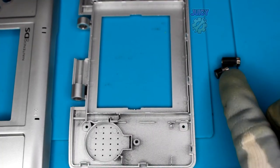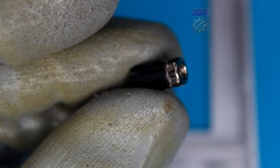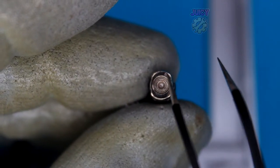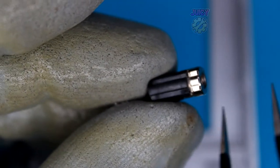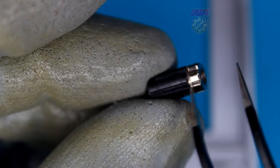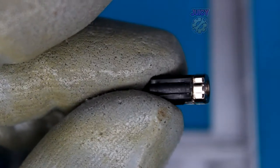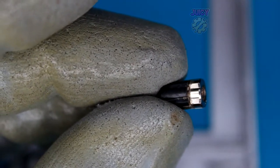Now let's replace the DS hinges. You need to get your hinges - there are two parts: a metal bit and a black bit. On the metal bit there's a bump on either side, and this bump needs to match the black plastic bits, which look like three lines. Check both sides match like so. Set up your hinges so we can put them in the case.